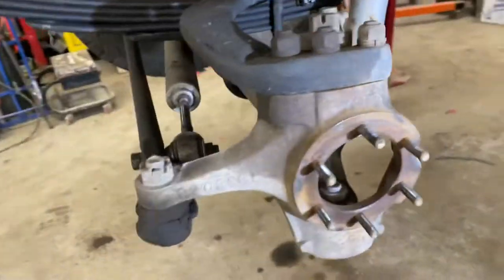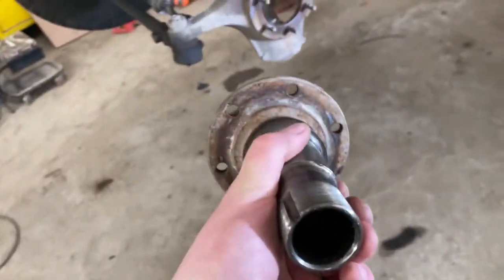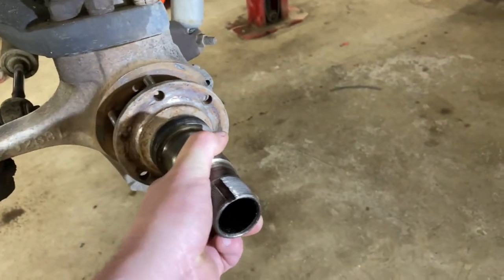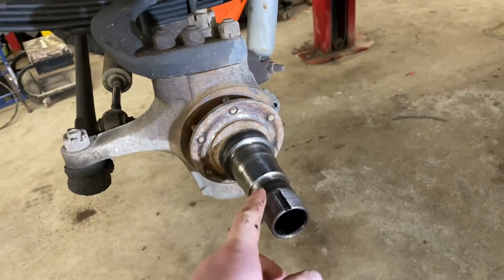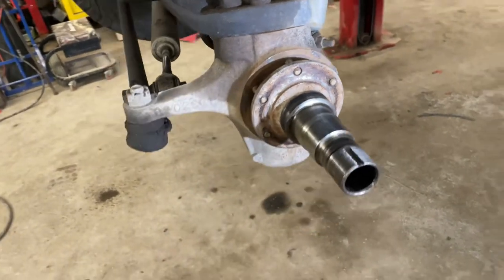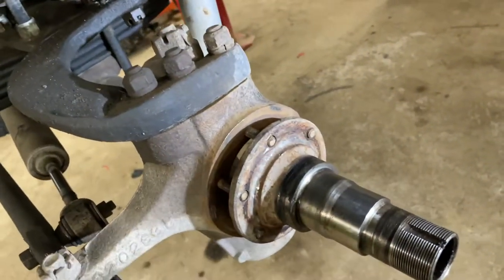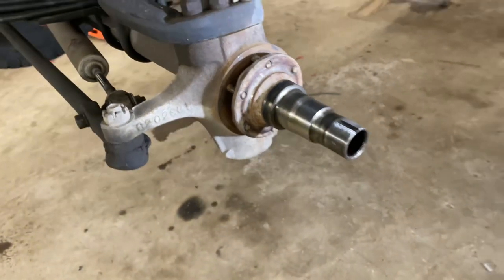This hub spindle is where it gets tough. The best way I've found to get these off — I used to have to do lots of U-joints and front end pieces when I was mud bogging, mud racing. With these, I just use an air hammer with a duller end. Usually they're seized on there — you can use lots of anti-seize afterwards. Just work it around, be gentle, and then it will all pop off.